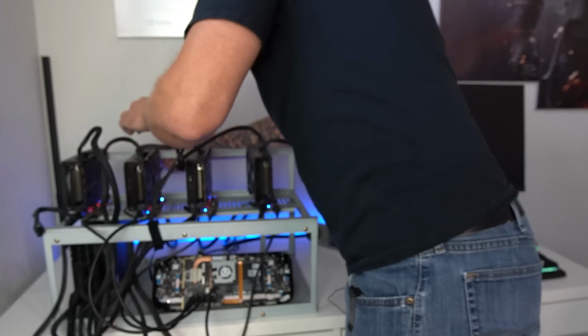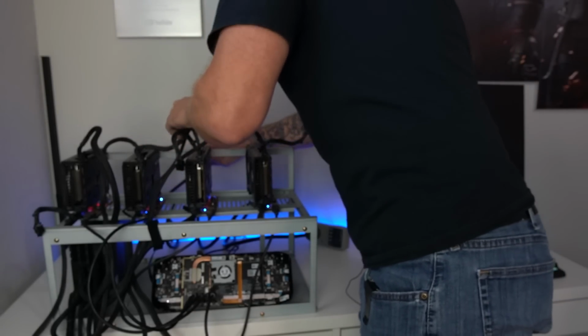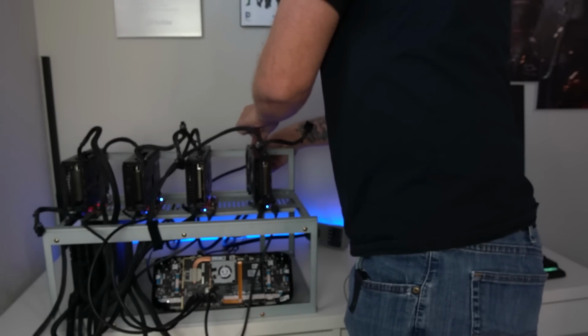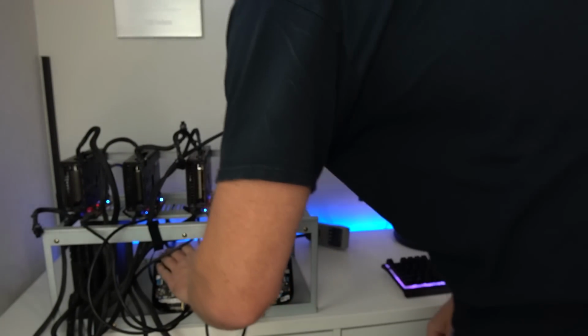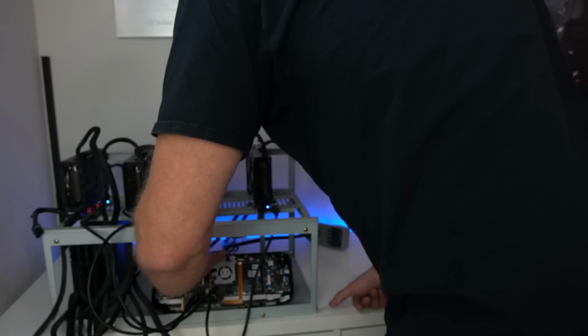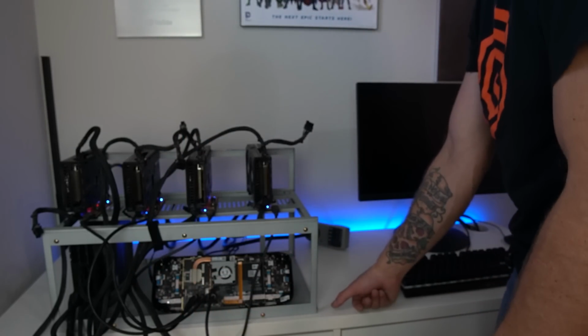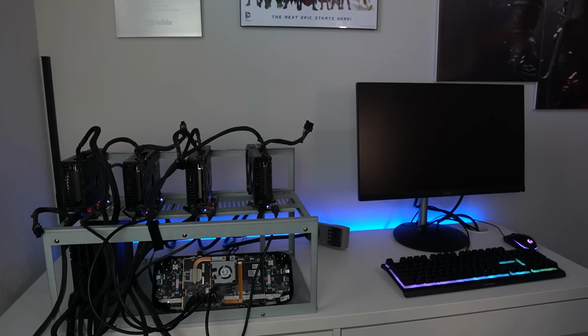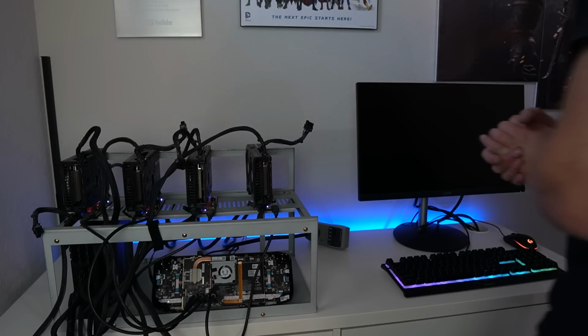Now this might not work, we might have to reboot with each one as well. I would assume it would be the first one, but I could be completely wrong. All right, so we're gonna go back to the first one, and we are going to power cycle the Steam Deck, turn it back on. The fans will come on. Do we get any video? Nope, no video, I don't think. We did get a reset over here. Still no video. All right, so here's what we're gonna try next.